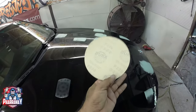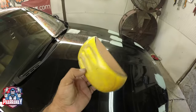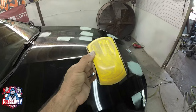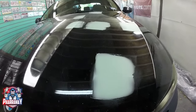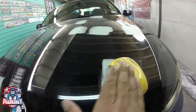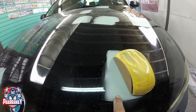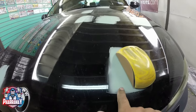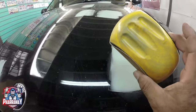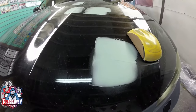I'm going to be using 220 grit for that. Let me install it on the block and show you how I'm going to sand it. Now I'm going to show you on this dent right here. All I've got to do is leave my block flat and go in a cross pattern motion — this way, then this way — until everything I don't need is eliminated. The only thing this block is going to leave is the body filler where the dent is.